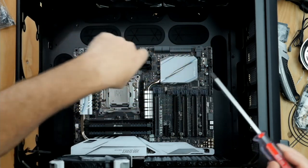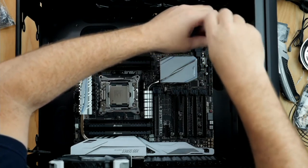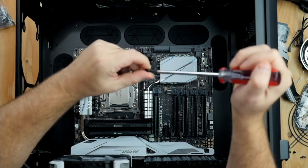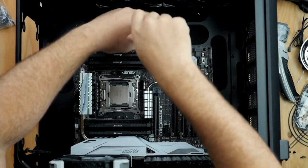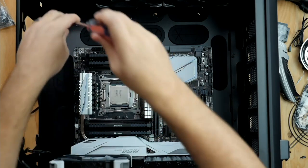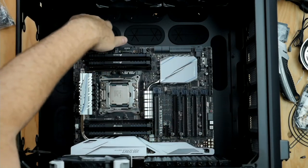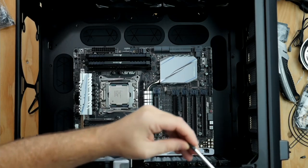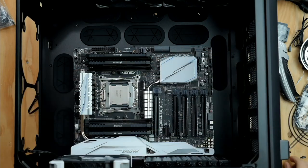Yeah, so I would typically not want to use the mechanical screwdriver that I've been using, or the powered screwdriver for this particular part, because these screws, when you're installing the motherboard, they really don't need to be tightened down. You want them snug, you know, you don't want them loose, but you don't need to crank down on them or give them any torque. It's really just to hold everything in place, and using something like a mechanical screwdriver, you'll probably be fine, but honestly, you don't want to over-torque it onto the motherboard, because you do have a chance that you might crack the PCB or something like that, and that would be a sad day, a very sad day indeed.